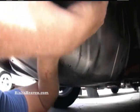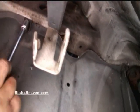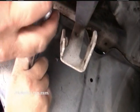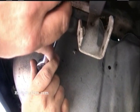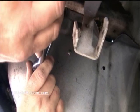We're going to drop the belly pan down and put a drop cloth inside of it, so when we take the original cooler loose, any transmission fluid or antifreeze we might dribble is not going to dribble directly on the ground. At my place in the country it dribbles on the ground, but in somebody's driveway or in the city, it's probably a good idea to catch it.